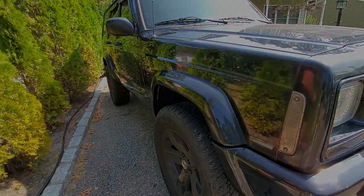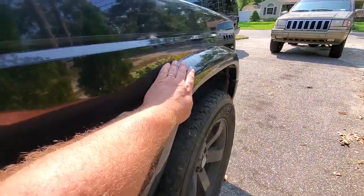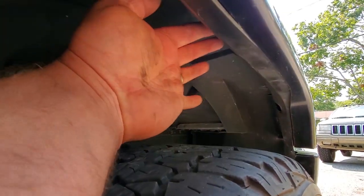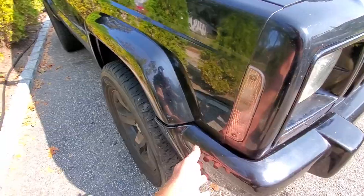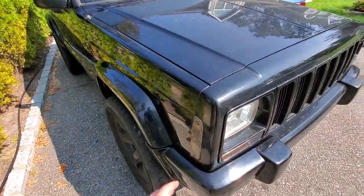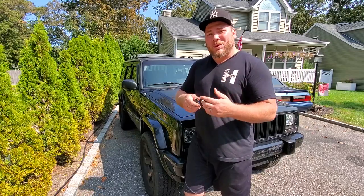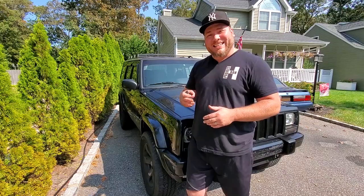We got the fender swap finished and everything is looking really nice — nice straight even gaps, fender flare on looking good and straight. Don't forget to put that 8 millimeter fastener to hold the fender flare on at the bottom, and the wheel well lining is back in place. We even got that weird little star nut washer going over the fender support — everything's solid, matching our bumper ends pretty good. Except for that dang dent. That's all for the fender swap video — hope you enjoyed it. Don't forget to check the link in the description to get yourself an antenna nut. Remember to like and subscribe and I'll see you guys on the next project.